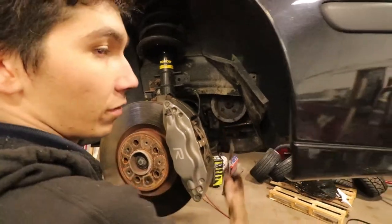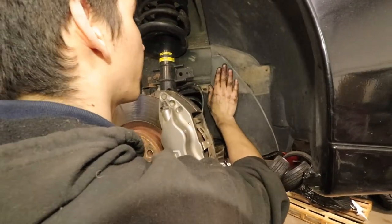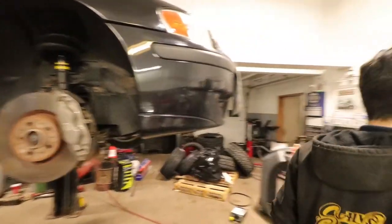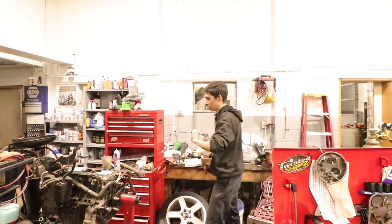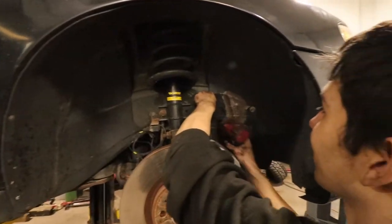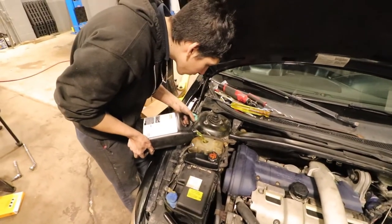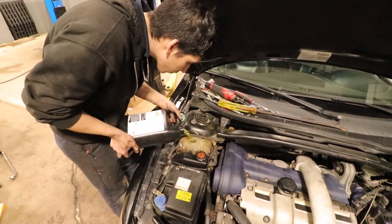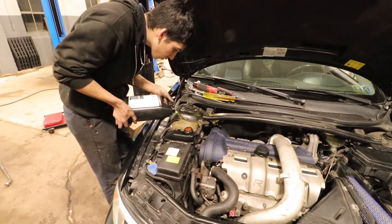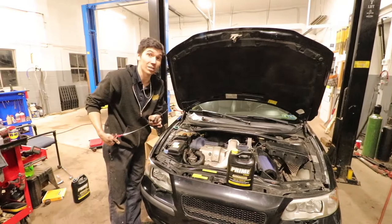Pull off the flush ribs, pull this down, make sure that sits on there, and get the plate back on. One of the most important things — don't forget to fill your car up with coolant because the water pump was off and you lost a bunch. Top her off. Now this is the final piece — we're about to start it up and see if she runs properly. Double-checking everything is done.